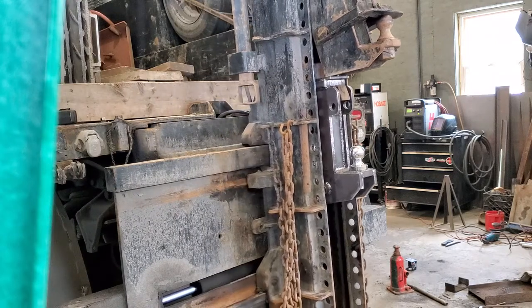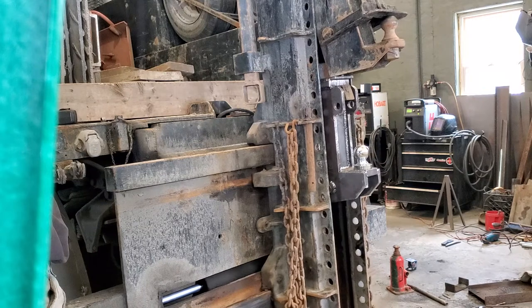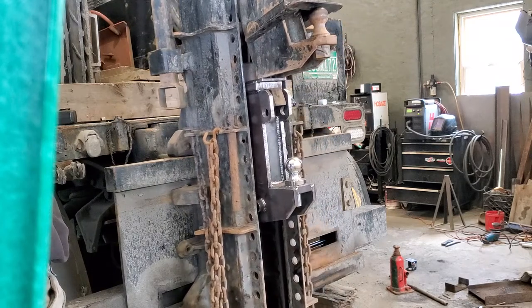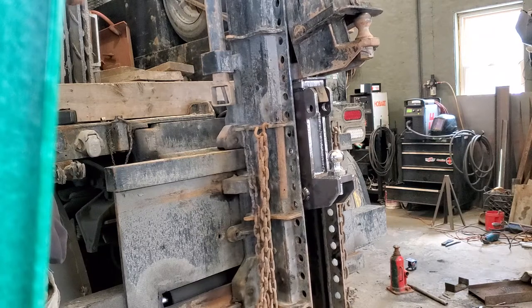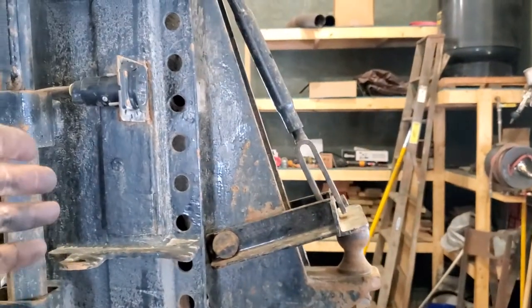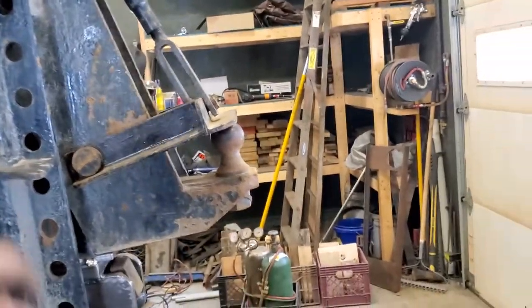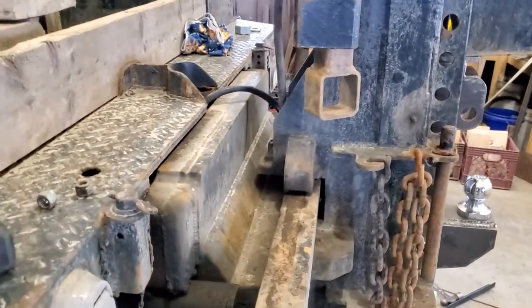The hitch slides side to side, about 32 inches, I believe. It comes straight out the back, 2 feet. You can see here I notched this wire into the body. That goes to my breakaway switch or taillight wires if you have a wired trailer with wired taillights, so that I can swing the hitch back and forth and it doesn't rip the wires off. Except I use a wireless taillight, so I don't need it for that. But I do use the power out of there for my brake switch, which I'll show you next. But anyway, hitch comes out 2 feet.